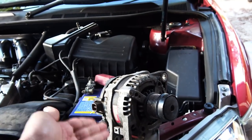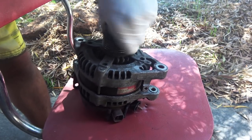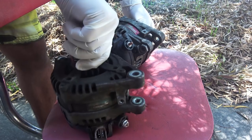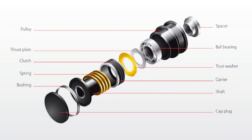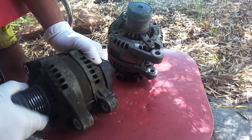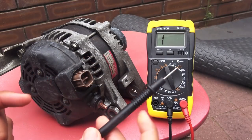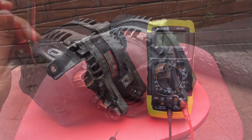Alright, it's daytime. There's a creaking noise coming from the alternator as I rotate the shaft — a common symptom of a bad decoupler pulley. In older cars alternators had a solid pulley, but modern alternators have a decoupler pulley that acts as a little clutch to protect the battery and alternator from overrunning and overcharging. A failing decoupler pulley commonly makes a worn-bearing noise for a few seconds after you turn off the engine. Even though we've found the problem, always check all components because sometimes more than one thing has failed.